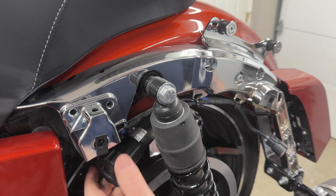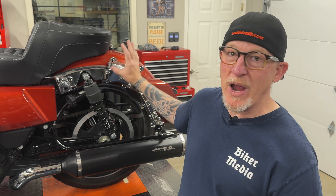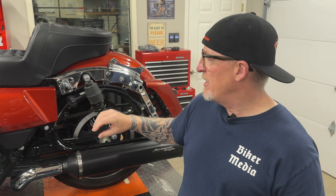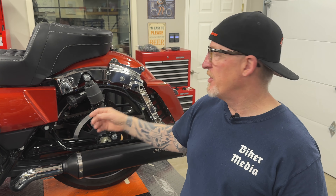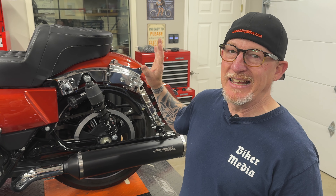This is a little bit finer adjustment over here on the left side for your hydraulic adjuster. If you were riding by yourself and you've got your right side gross adjustment set, and all of a sudden you added some gear or a lighter passenger, instead of getting a spanner wrench out and adjusting the right side, you can make some of those adjustments over here. That's why we want to make sure and get the right side set properly first.